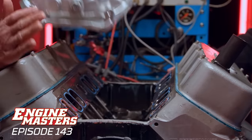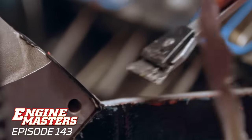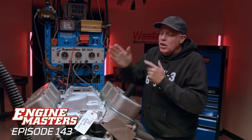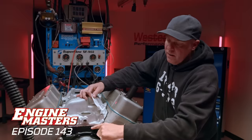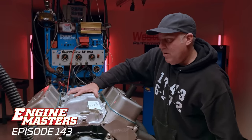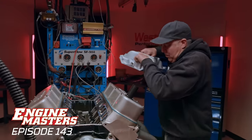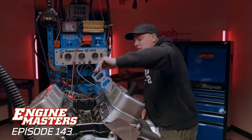Continuing with our 454 intake manifold shootout, we've tested the Speedmaster, and now we're going to the Edelbrock Performer 2.0 for oval port. Remember I was pointing out that manifolds don't always bolt right up? Check this out. The end rails are touching the engine block right here. That means even if I put some silicone in there, it's gonna leak, because see how the manifold just walks around like that? So on this particular intake, and this might not be true on your engine, by the way, it's just on this combo, we are going to have to stack gaskets.